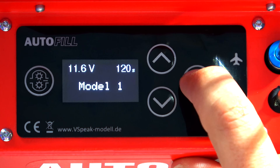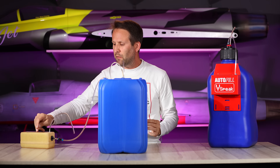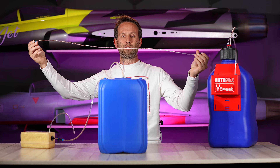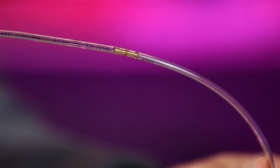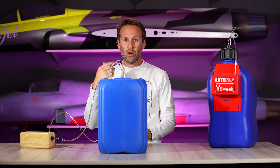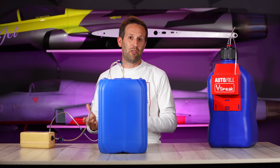There is one difference compared to a fuel bag. Fuel bags by their nature build in pressure the more fuel and/or air is inside of them, which is what this can read — the pressure. Now, rigid fuel tanks don't quite work the same, as obviously they have a breather tube which allows some degree of the pressure to escape. That's why we need one of these reductor hoses. We can just connect that to our breather. This just has a little nipple in here which reduces how much fuel or air can get through. We can either leave this off, or connect it back into our fuel bowser — after all, we want to be environmentally friendly. So as soon as we start filling up, it'll fill as before, and when it reaches that restriction, it knows that it's full, just like with the fuel bag.